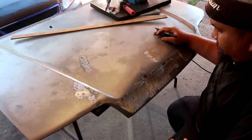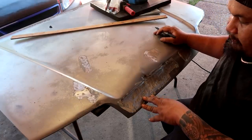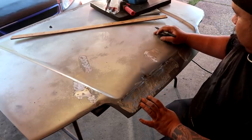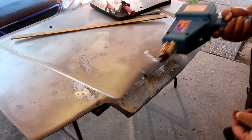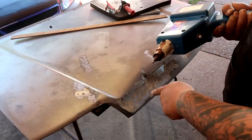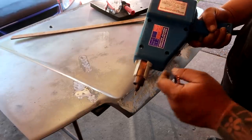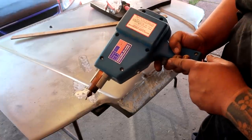Damn, that's a lot of spot welds. I'm probably going to skip around some of these markings and I'll know where to put another stud once I start pulling. So what you want to do is put the stud into the gun. This won't activate until you ground it out to the body panel. Hold the trigger down while depressing it all the way flush, and hold the trigger down for no more than two seconds.